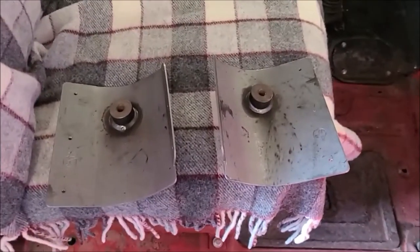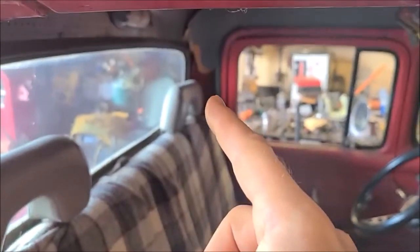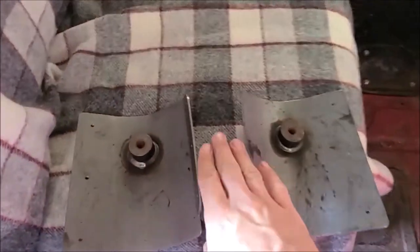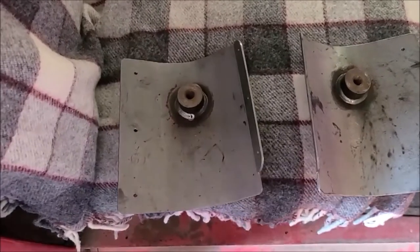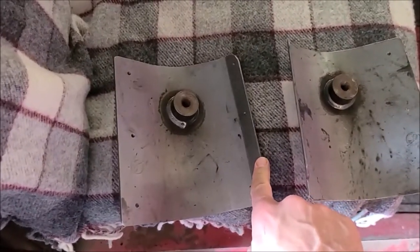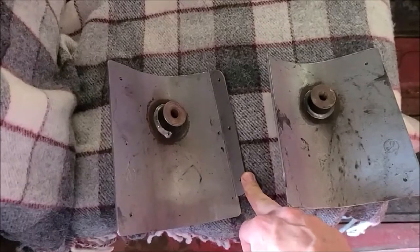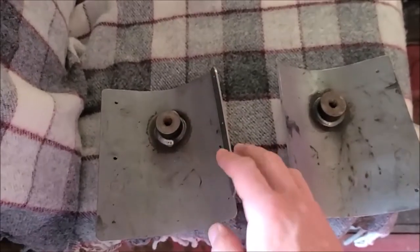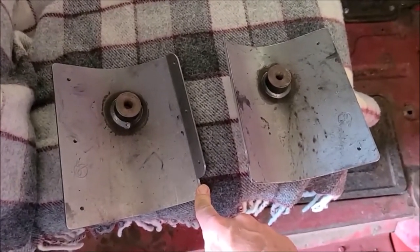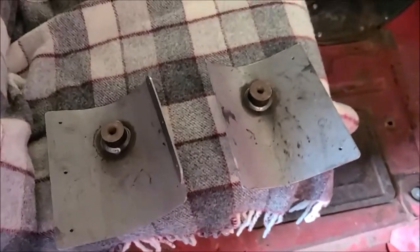Today I'm working on installing three-point seat belt brackets I got from mid-50s. They mount up into the cab corners on each side, behind the sheet metal, so the whole cab corner provides strength for the mount in an accident. You can either screw them in or weld them in. My plan is to weld them in - I think they're stronger that way. Technically I don't see why the screws would be a problem, but I think it'd be easier to weld them in place than figure out where the holes line up.